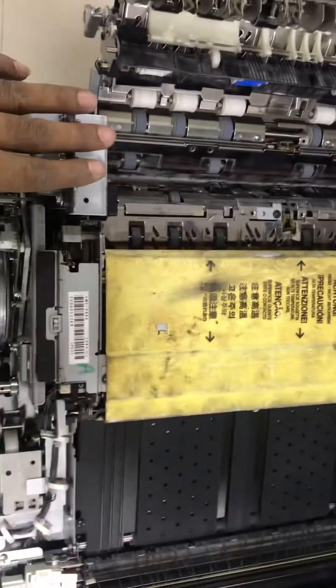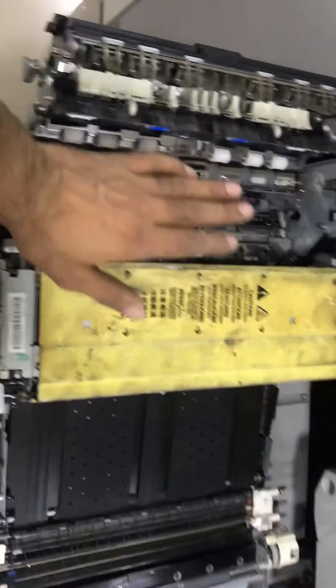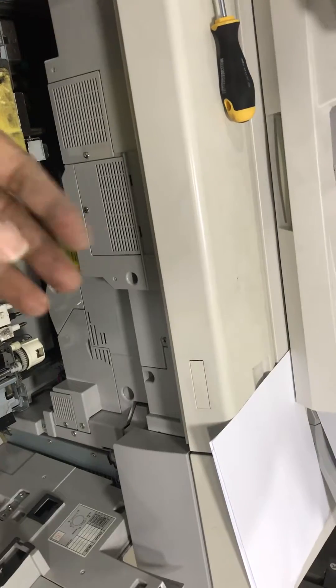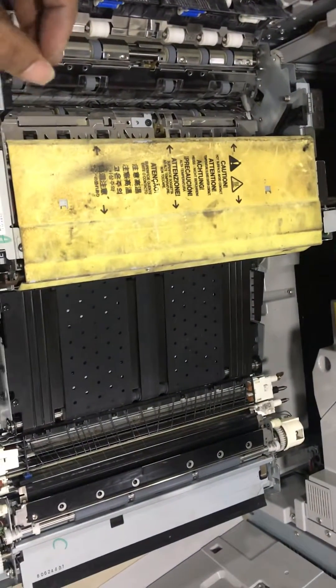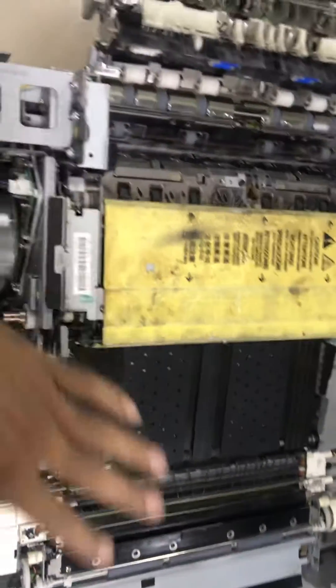The fault is in the sensor. If you close this heater door, the display will suddenly shut down like this. If you remove it, wait a little time, then power on the machine again, it works normally. If closed again, the display shuts down. The problem is something shorting in this area.